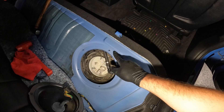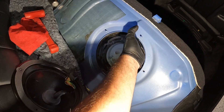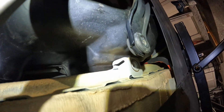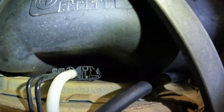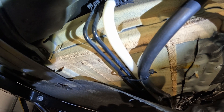That little gap underneath is literally right here. Shove it as far up as you can — you'll reach as far in as you can and you'll be able to feel the ventilation line, and the supply line would also be there. I also forgot to mention that you're going to want to at least lower the fuel tank. There's a bolt right here and a bolt right here which holds the straps, because that's how you're going to get that extra inch of movement. I routed it from on top of the e-brake and driveshaft. Unless you somehow manage to drop it enough, you have to get over this little rubber grommet here — I tried, it does not make it. So I'm routing it here under.